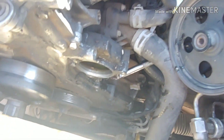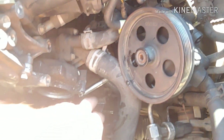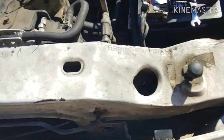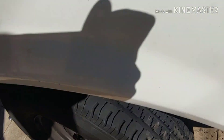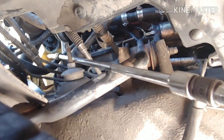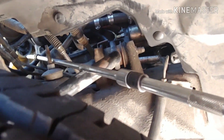So we got the water pump off. I ended up breaking the tab off of the top, and then I had to take my extension and come through the wheel well. It was stuck — that old water pump had the wrong gasket on it, it was way too big. I ended up coming through here and putting the extension on the back of the pump, then smacking it with my rubber mallet, and then just walked it out.